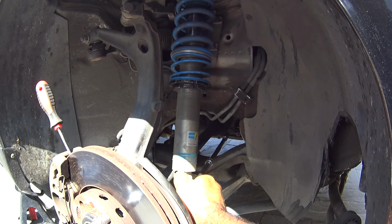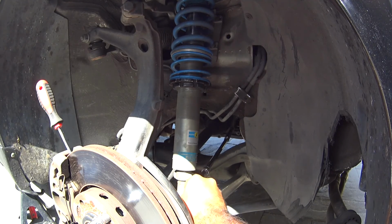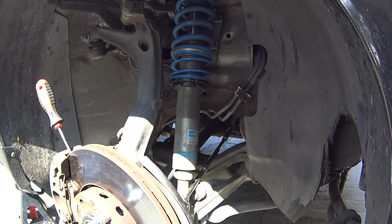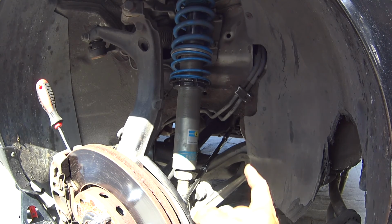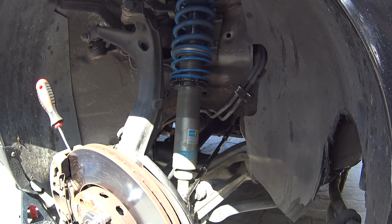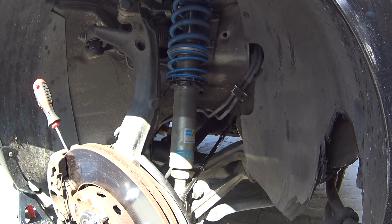all the way, and you're going to get to one of the bolts on the actual axle itself. Since I already broke loose the axle bolt on here, worry about that later. Get the axle hub on the back. There's 6 of those M10 triple squares. Break them loose however you guys want to do it. I use a longer breaker bar just to break them loose, and then I use my ratchet to take them off after that. Repeat the process 6 times, obviously, because there's 6 bolts. Once that's done, I'll show you what to do next.